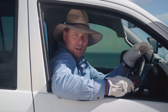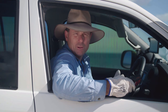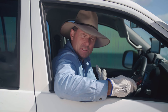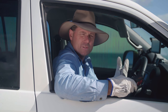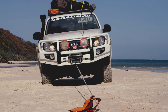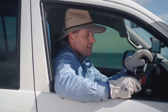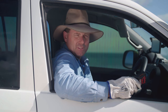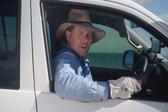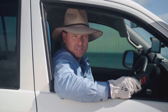There we go. When you're using a ground anchor, it's a good idea to consider that you're not tying off to something like a giant gum tree. So to give it a little bit of a hand, it's a nice idea to just idle forwards a little bit — that just takes the pressure off everything: the anchor point, the cables, the winch, the works. But we've got this one out, no sweat. Now I'm going to do a bit of a cheat — rather than digging this tire out, I'm actually going to drive up a little bit closer to it and try to pull the anchor point out with the winch. Saves a bit of digging.